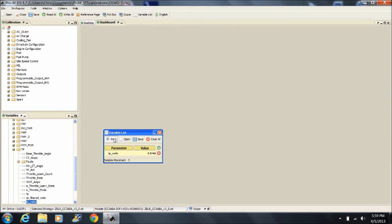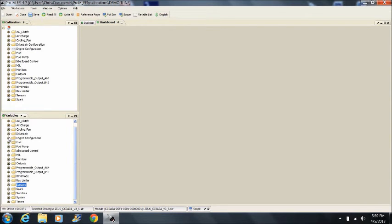I know you've been told 0.98. Please change it to 0.95 or less. 0.98 is not correct and it never was. In fact, the Mustang computer worked best at 0.90 or less. The Pro-M EFI processor will work fine with it as high as 0.95.